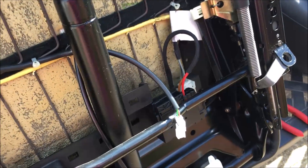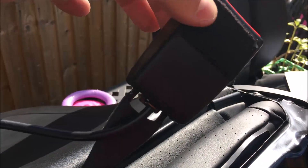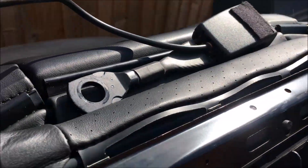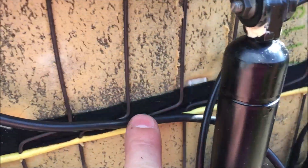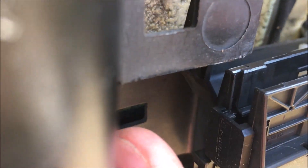While the seat is out I'm also going to release the bottom of the seat belt. There's a little cap here that sits on top - pry that off and then release the bolt underneath, because that needs to loop back through the side of the seat so it sits nicely close to your lap. One difference on the driver's side is it has a connector to the seat belt receiver electrical connection for the seat belt warning. Release the bolt, then the cable routes down through a couple of tabs. There's a little cap on the side of the block - pull that up and it pings out, then the white connector can slide out sideways.